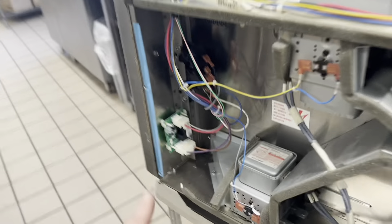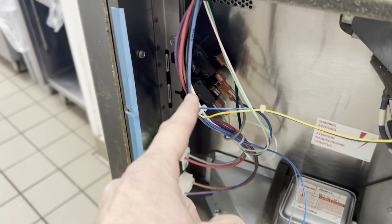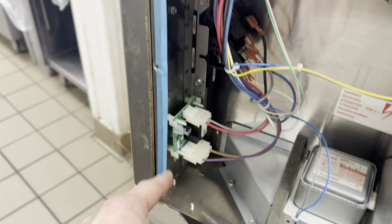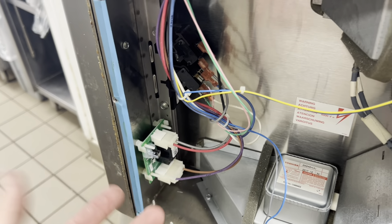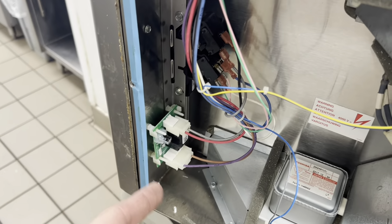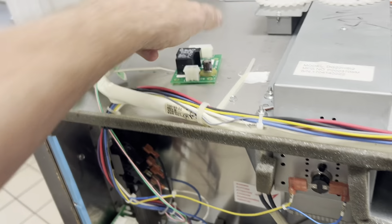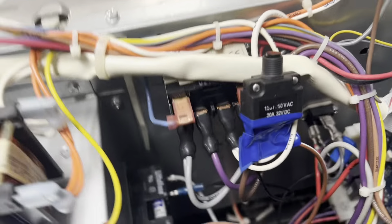This board ties into the door catches, so it can be that this is the problem, and when you unhook it the tripping also goes away. You test that by putting a new one in - if it still trips then you know it's your door switches instead of your relay. In my case it was the relay. So now I'm going to get rid of my popper and put a real fuse back in there.